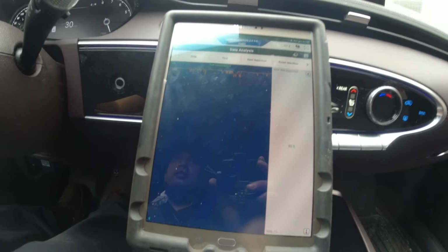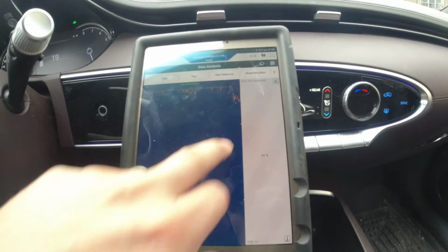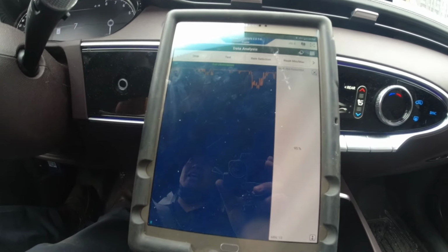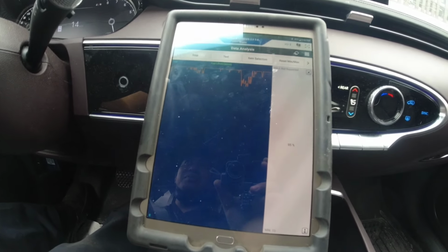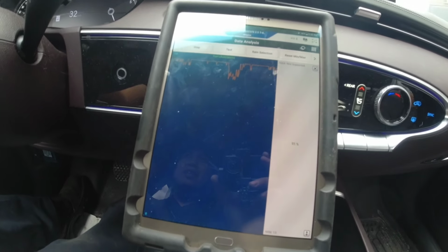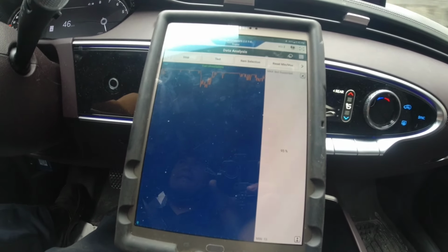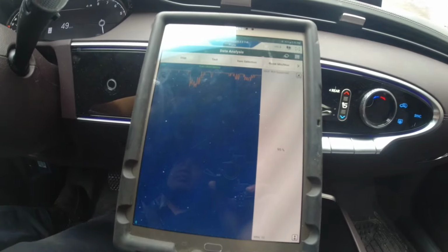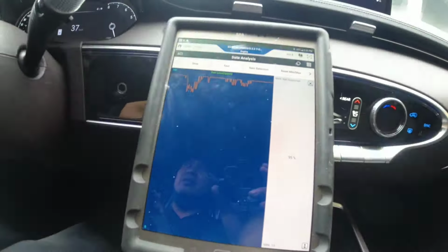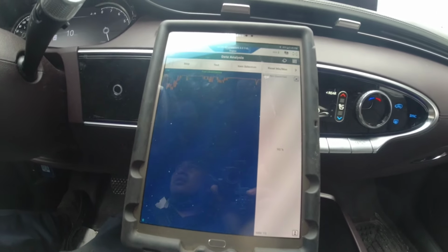Okay, I'm gonna turn right here. See, you see that drop? Turning right, I don't know, but I filled this gas tank to full though, so that level sensor should not move around. I wonder if turning left is the same. And I don't remember during my testing if I graphed my fuel level sensor here on the scan tool and wiggled the wires. I'm not sure.